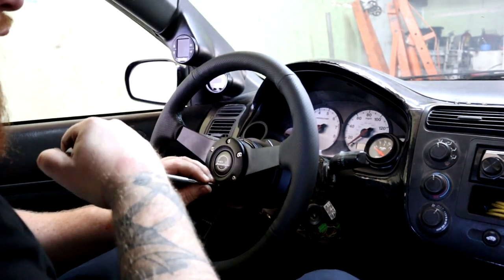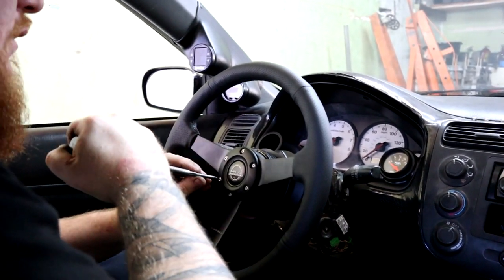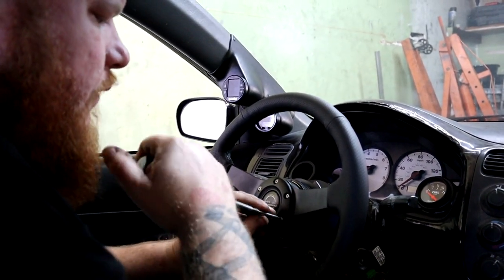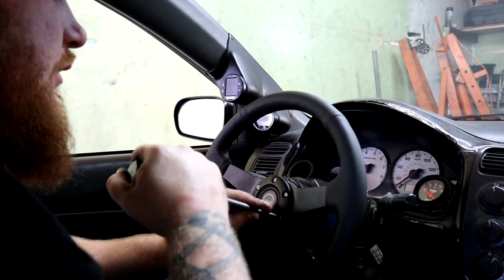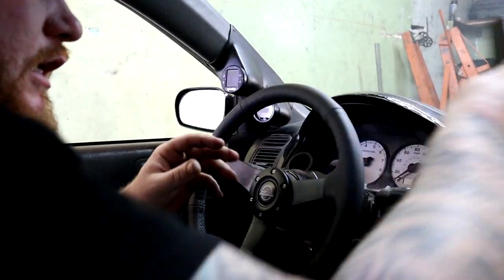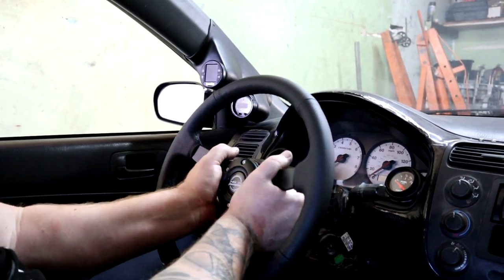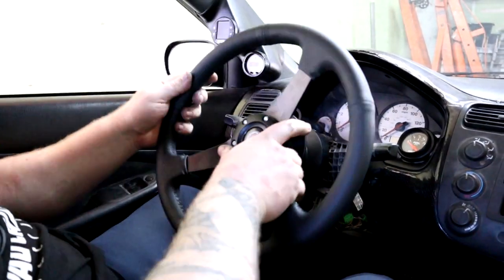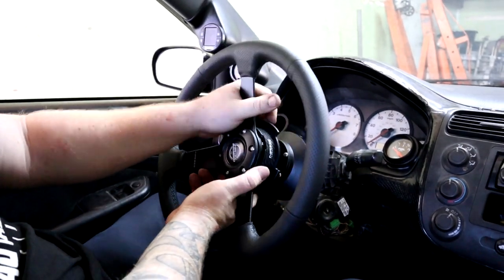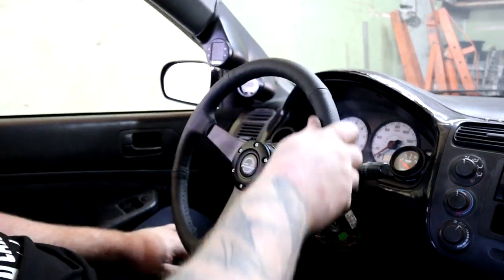The horn works — it's live! I've got that horn to honk at stupid people doing stupid things on the road. Let's get these cinched down. It's pretty level; I can always mess with it later if I need to. Tighten it all the way up — make sure these screws are tight, you don't want things coming loose when you're driving. I've had to put Loctite on some other customers' setups. The horn works — that's an important one. Test the quick release: the reason for quick release steering wheels is if you have racing seats it makes it easier to get in and out. Works good, and then comes off no problem. It only attaches one way — if you put it on crooked it's not going to attach. Then you spin it — super easy, real nice steering wheel.